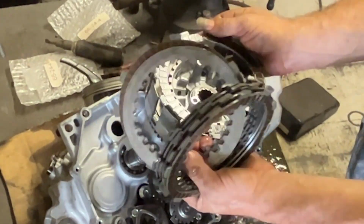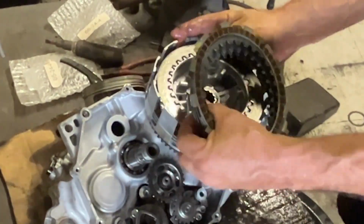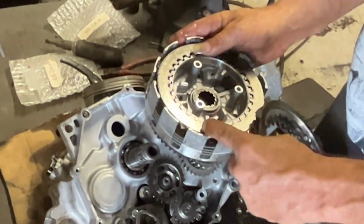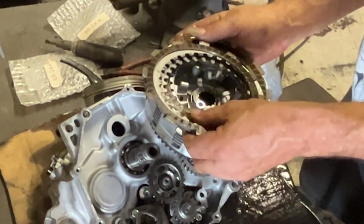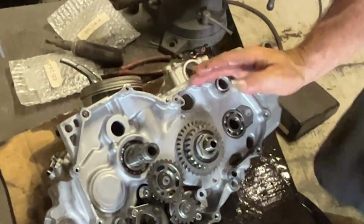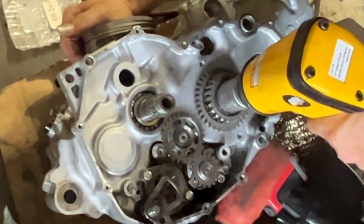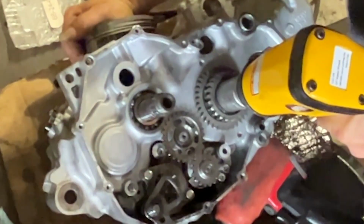Turn around, we put all the plates and everything back in the basket, so again, nothing gets lost. This set of plates is interesting because it's got a skinny plate that goes on first, standard plates that stack in, and then it's got 2 more skinny plates that go on top. So the order of those clutch plates is critical. 1 skinny, standards, 2 skinnies.